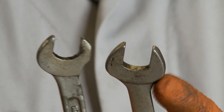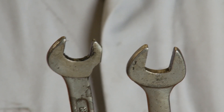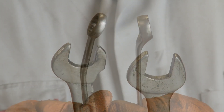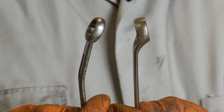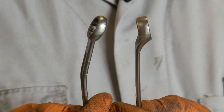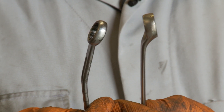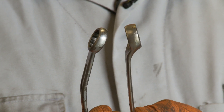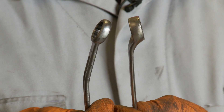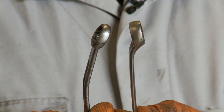You'll find that a normal spanner fouls on the caliper itself and you can only therefore turn it an eighth of a turn at a time. The angle I've bent this spanner is just a little bit — you need to angle it slightly in order to clear other bits of the car. You can make that bend slightly more to make it perhaps slightly easier, but it depends on personal choice. Putting a bend in the spanner is always useful, and you will need another 14mm spanner to undo the lock nut as well.